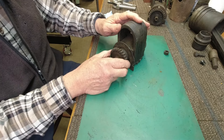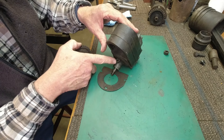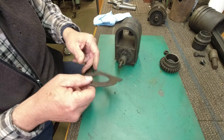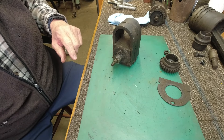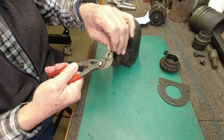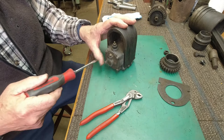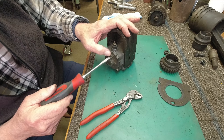These things are very simple. There will be an oil slinger felt on here. This has kind of an open hole where inside the crankcase oil will eventually make its way into that hole. This is just the shield or cover for it. Then we've got a little Woodruff key in here — a little half-moon Woodruff. And there's an oiler here. This one needs a little tension; it's got a bent lid on it.